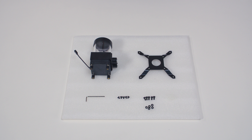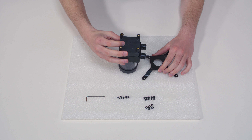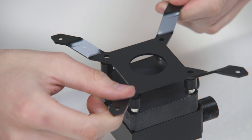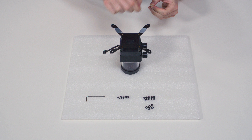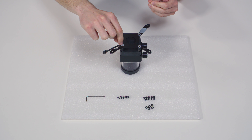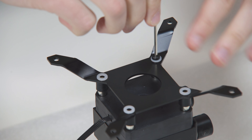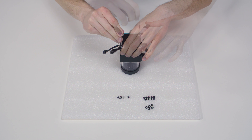The Fluid Gaming Kit comes with a combined pump and reservoir unit with pre-installed anti-vibration decouplers. Take the unit and place it on the enclosed spider holder. Secure it from the bottom side using four M4 x 4 screws and PVC washers, tightening them in a clockwise direction using the 2.5mm Allen key.